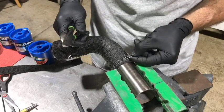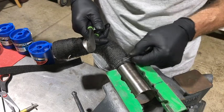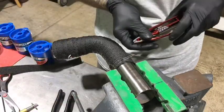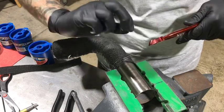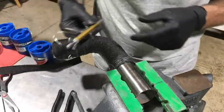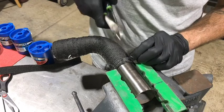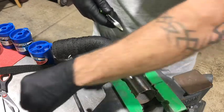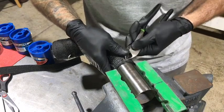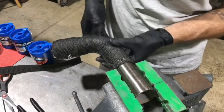You'll have two wires left and what you do with them is up to you. You can cut them short and push them in, or take a safety wire tool and actually twist them together. But once it's bent with the clamp tight tool and that bends over, it's not going anywhere. So just push it down, trim them down real tight, and use the end of the tool to push them in as tight as you can so nothing gets snagged. That's basically it — safety wired and wrapped really good, real tight.